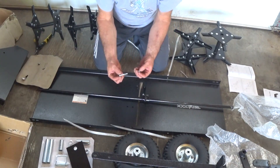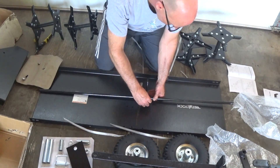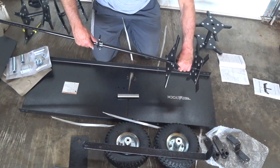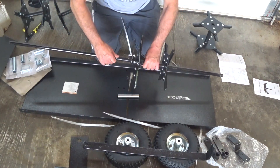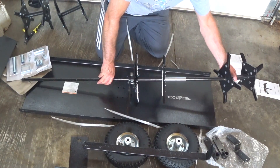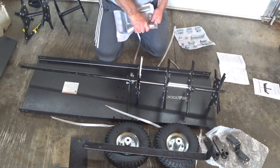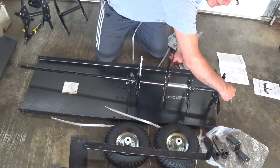This is a quarter-inch by 1 and 9/16-inch bolt, and this is the quarter-inch lock nut. I'm just going to loosely assemble everything and tighten it up once we get going. Make sure the flat part here is to the short end like that. Then a long spacer goes in, and then the second set of tines. Then a 1-inch spacer, and then the big flat washer at the very end.